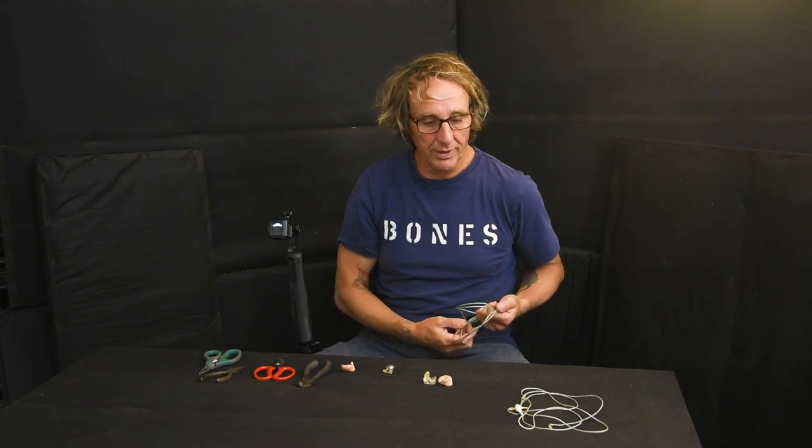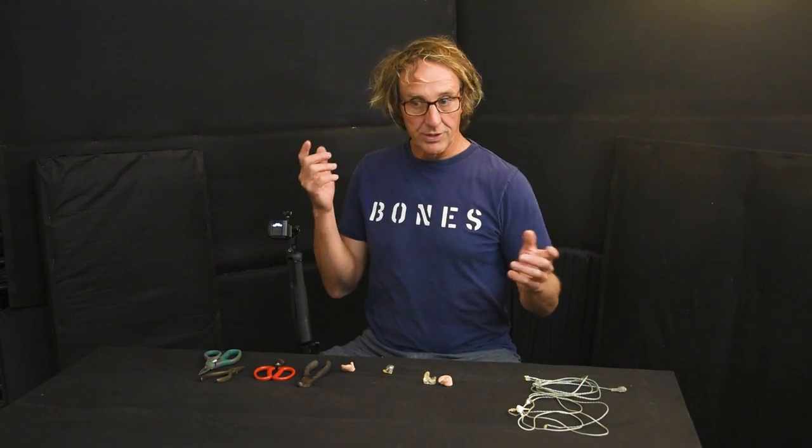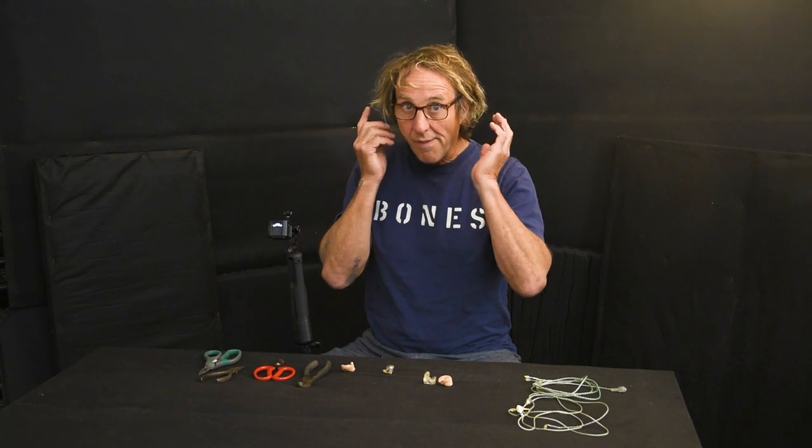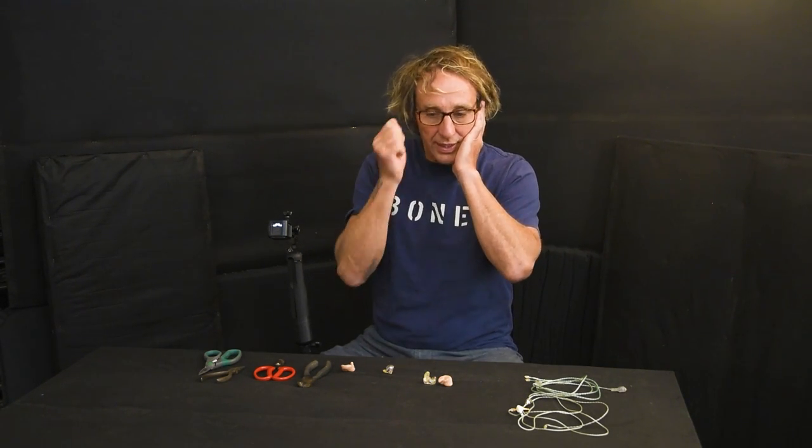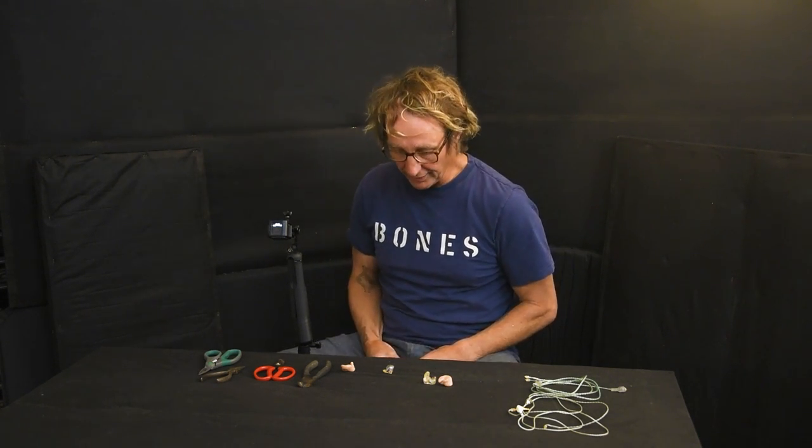Get a new pair as a reference point, then using one ear from each pair at the same time, you can plug them into a mini-plug Y adapter — put one ear in and then check a whole bunch of sets fairly quickly.